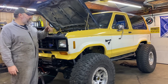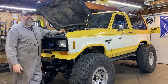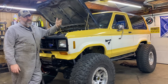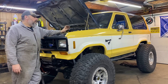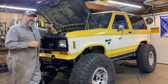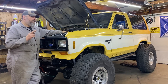So I talked to Jeff, and after I pulled the fuel rail off and took some fuel injectors over to my table and tapped on the table, just crap falls out of the injectors. Don't know the condition of this motor when Jeff got it — this motor could have been running like that before it was pulled out of the donor vehicle. So I bought a kit of AC Delco coil packs and some stock injectors to freshen up the ignition. I already have brand new Taylor wires, some heatproof boots for the plug wires, and it's got NGK Iridium plugs brand new. We'll put all those in and pray that the misfire goes away.